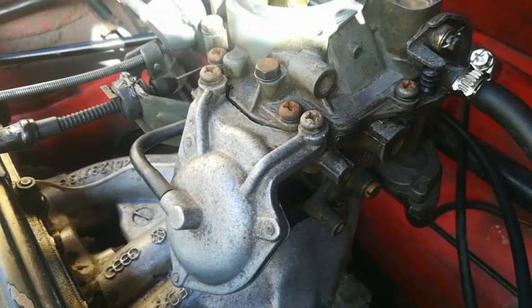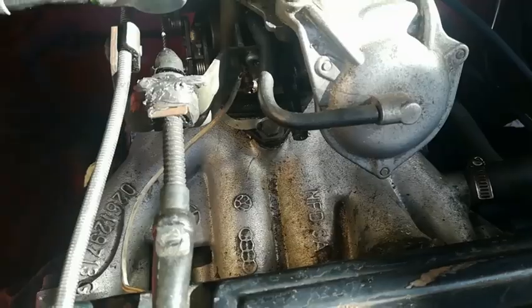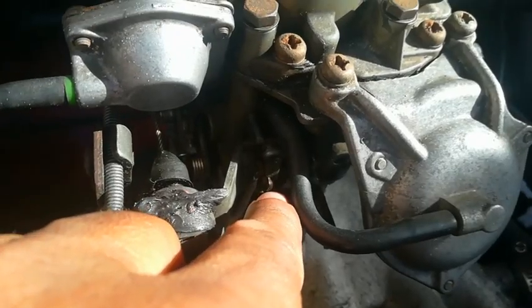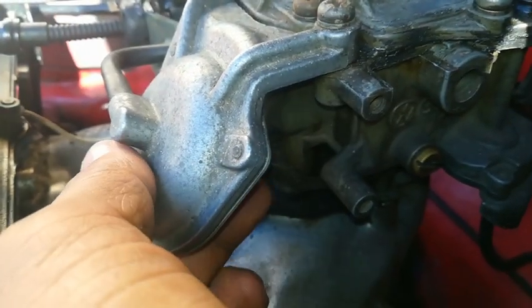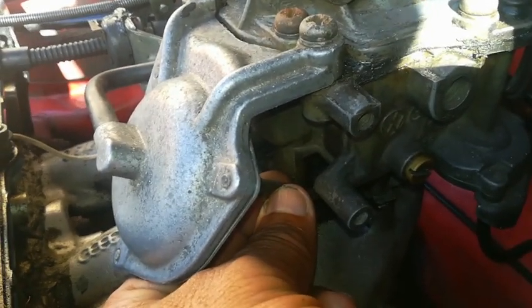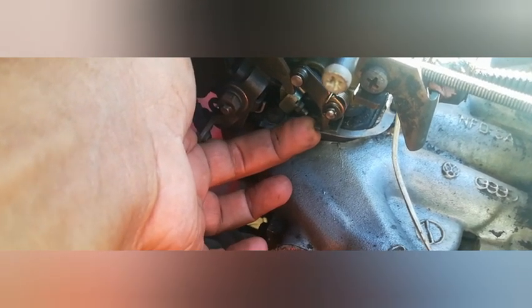The second stage operates by means of a vacuum. This is the actual component where a diaphragm sits, and on the same component sits a short little pipe which is connected to the carb — connected to a port that sucks air. When I say sucks air, I mean engine vacuum sucking on the diaphragm, and that in turn will pull on the lever that is on the inside of this component. It pulls, and that pulls your second stage butterfly open. You may want to know if your second stage is actually working or not — which is basically this little lever here, which goes in and out as the engine vacuum pulls on the diaphragm.